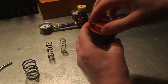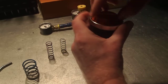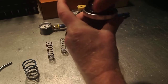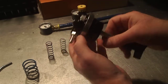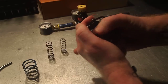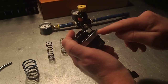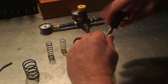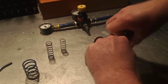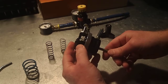Make sure you remove any debris that might accumulate around the edge of the diaphragm — you don't want to pinch that in place. I've found in the field it's much easier to thread the top cover into the ring than to thread the ring into the top cover. Once you get the cover down fairly snug, you can align the logo artwork if that's important to you, and simply draw that collar nice and snug. This does not need a tool. Ultimately the spring loading inside will prevent the locking ring from coming loose. It does not need sealant and it does not need any lubricant either. Once you get to that point you can then unload the spring pack again. Your actuator is reassembled — slightly stiffer spring this time.